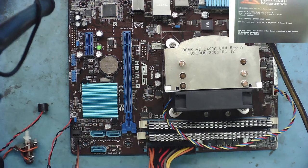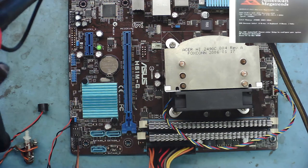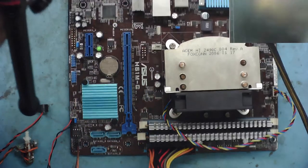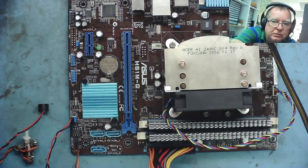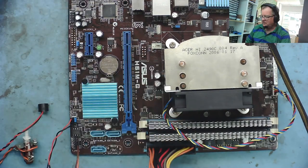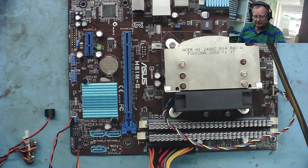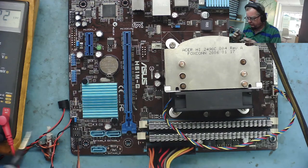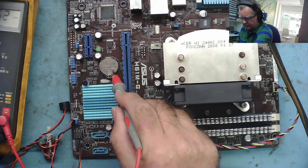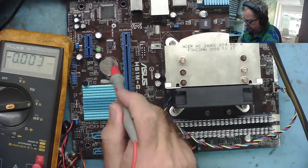It bleeped once — that's a good sign. There we go, ASUS! So it's booting. i7 3770 at 3.4GHz — 'New CPU installed,' that's interesting. I wonder if it just lost its settings from previously. That was obviously a very dusty old CPU. Let's check the CMOS battery — yeah, 3.2 volts on the CMOS battery, that's good.